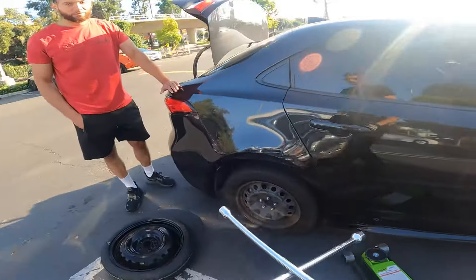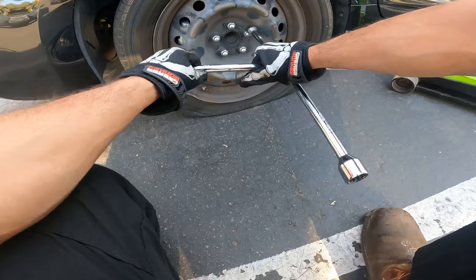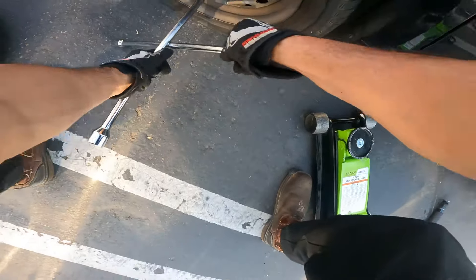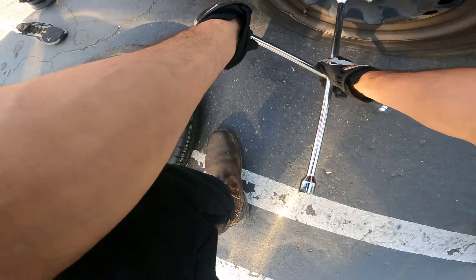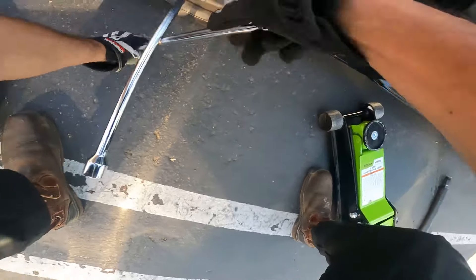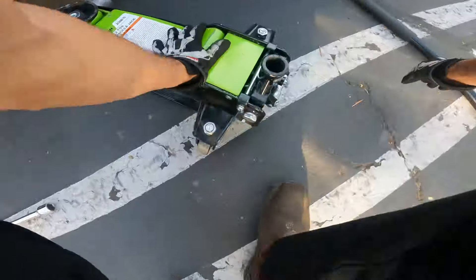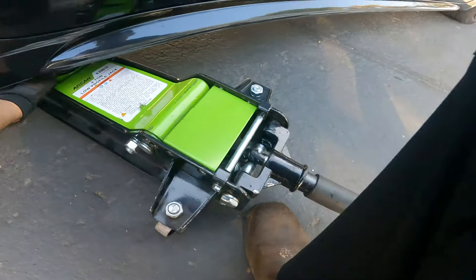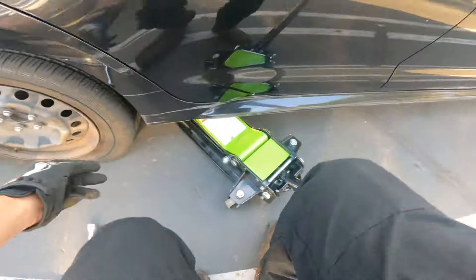If you try to do this on your own next time, I'll give you some pointers. The most dangerous thing is a car that's in the air — it can obviously hurt you or somebody else. Be careful. You always loosen these lug nuts when it's on the floor. When the car's on the floor like it is right now, you loosen them — probably do something like this. Right, exactly. So you just loosen them on the floor, and once they're all loosened up a little bit, then you can hook the car up. There's a spot right here where the body welds to the whole frame — it's really strong — and that's where you jack it up from.